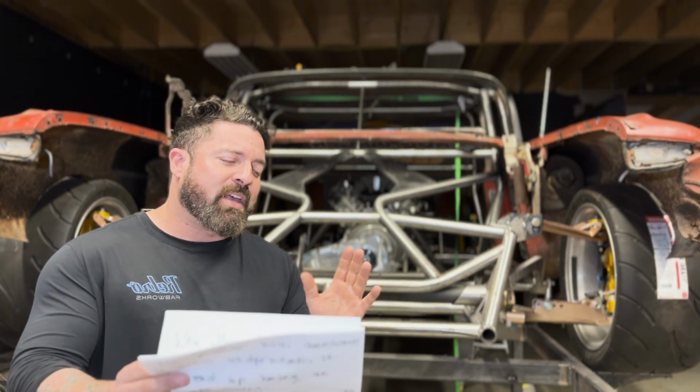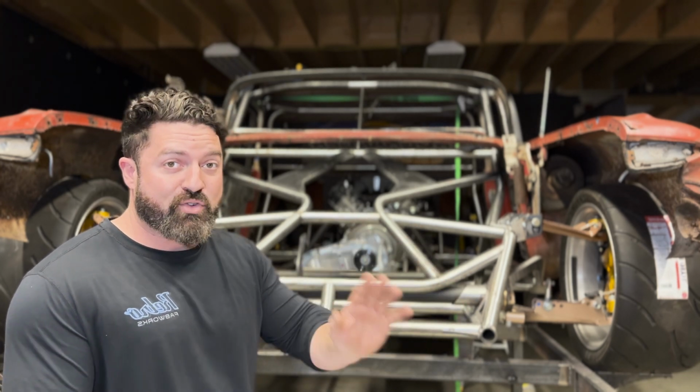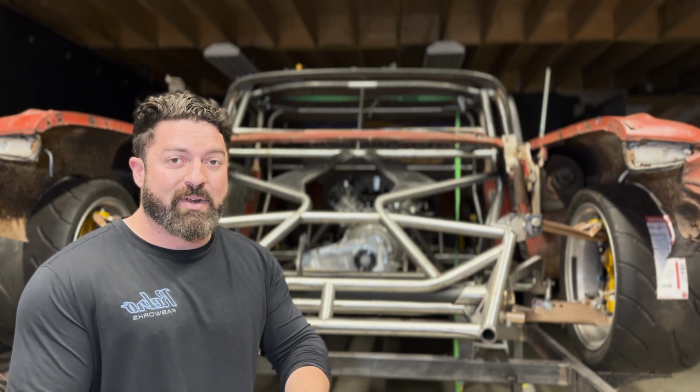So I kind of did a couple things different. I didn't do turbos because I wanted instant flash, which you still can do, but I went with a crank-driven Pro Charger for the simplicity of it, for the ability for me to beat on it, to be able to service it quickly and not have things crack and whatnot with, say, headers. Because I am going to put a lot of street miles on this car. The whole goal with this car is I'm going to drive it across country once I'm done with it, when I finish SEMA.